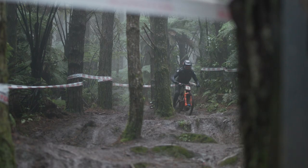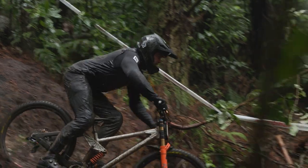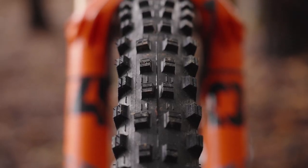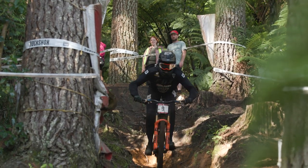The first two days of practice were super muddy here, so these tires are kind of an intermediate mud tire. It's an open tread pattern that sheds mud really well, but also has a shorter depth tread pattern that is better on roots and rocks — it's more consistent across different surfaces.